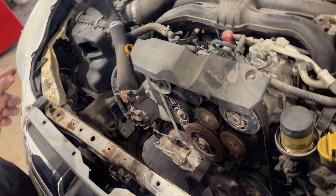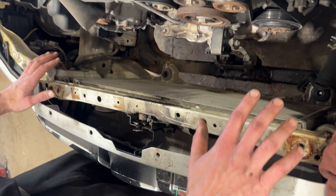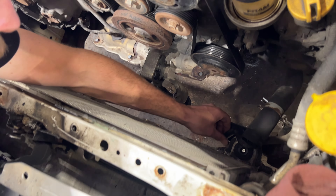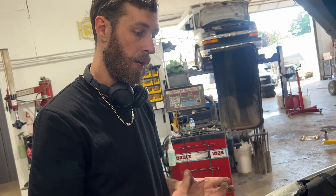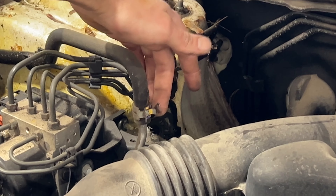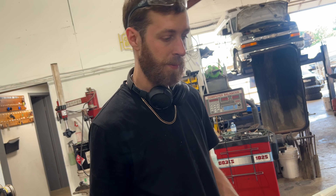This one was really rusty so I ran into a lot of issues with seized bolts — pretty much every bolt was seized. The two top ones for the brackets were seized; I had to put heat into them to get them out otherwise they would snap. The two hoses that run for your transmission cooler that go into the bottom — the clamps were super rusty, and as soon as you go to use pliers to squeeze them, the ears break off. Then you have to cut them off with a cutoff disc, being really careful not to cut the hose.